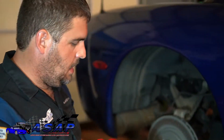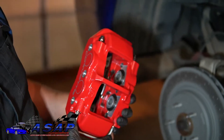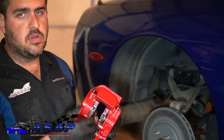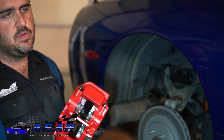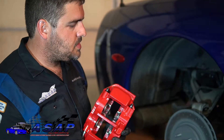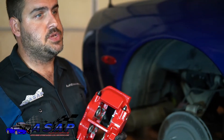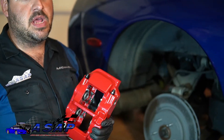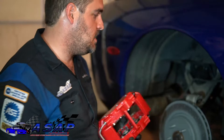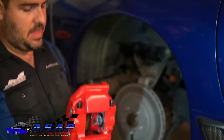Just like the front, make sure you've swapped the crossover lines to the correct side — crossover line on the bottom, bleeders on top. There are two ways to do this: you can put the pins in and pop the pads in before mounting, or mount the caliper first. It can be a little fun getting over the rotor with new pistons out a bit. This also gives you good practice for when you do a track day and need to swap to track pads quickly. Mount it down, same 125 foot-pounds on the two mounting bolts.